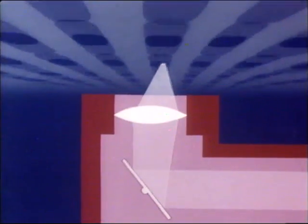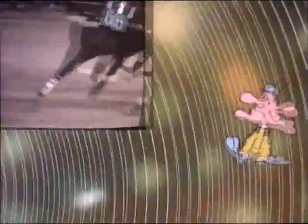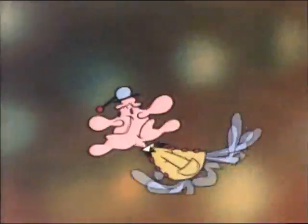By the protective layer of plastic, scratches or dust will be kept out of the focus of the light beam, while the light beam guides itself to follow the track very precisely. The row of indentations is so tightly rolled up that one disc contains tens of miles of length. Our light point scans the spiral from the middle. Every rotation of the disc is at least one picture. And now you will understand how we achieve stop frame — stop the light point on one winding of the spiral. And when we put the light beam in the other direction, we get the scene backwards. Forwards, backwards, slowly forwards, fast forwards, very fast forwards.